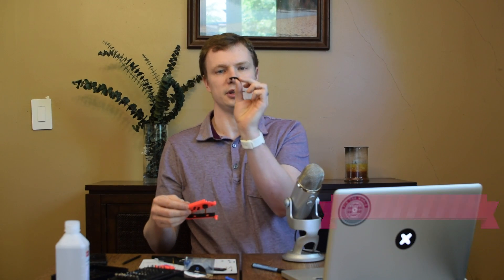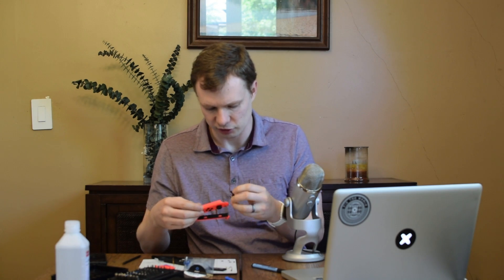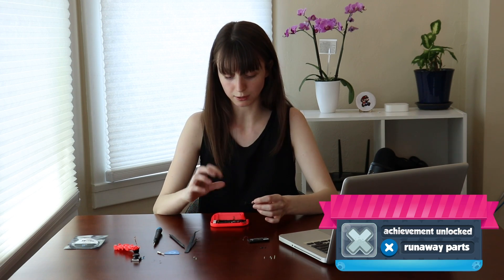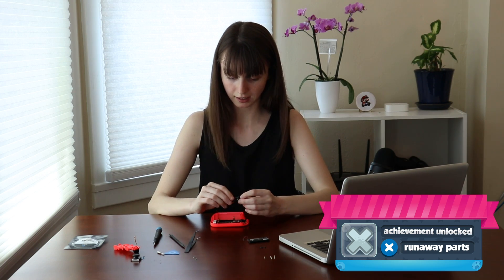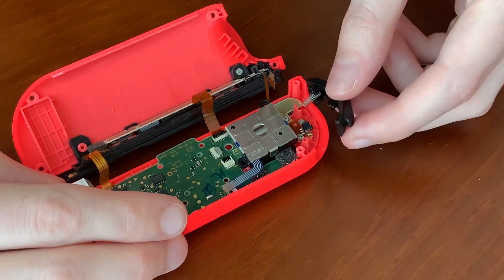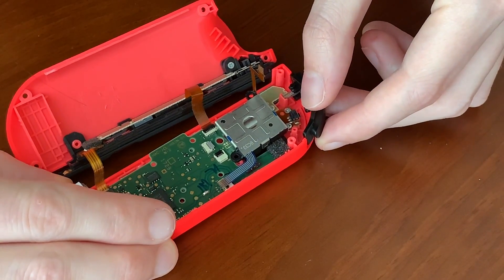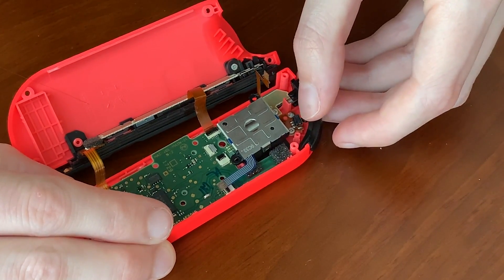Here's my first dummy move — the bumper, the L button, just came off while I was inserting the new joystick. So I'm going to figure out where that goes. All I had to do was reinsert it so that a little spring aligned with a little square. Sometimes instead of tightening the screws, I'll loosely insert them until everything is lined up correctly and then tighten them down.